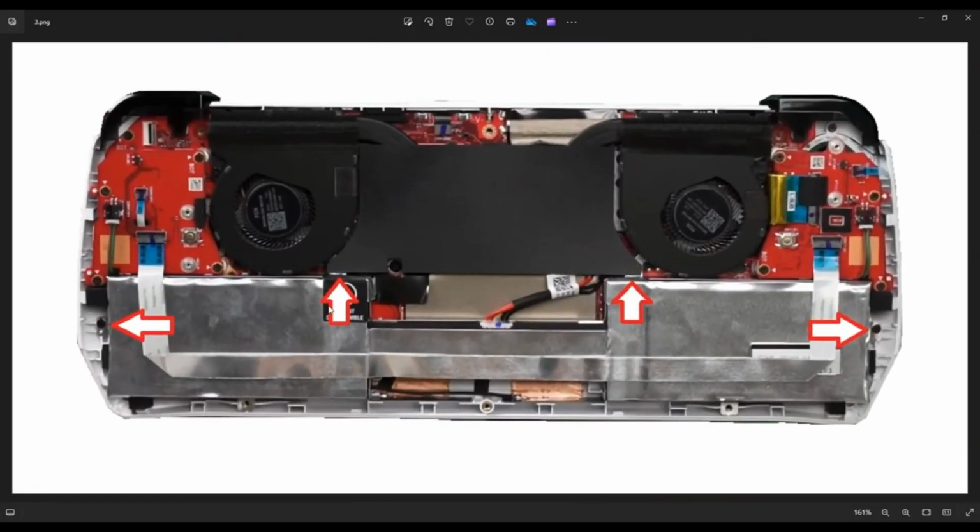After unscrewing all four of those screws, guys, you have this plug right here that comes from the motherboard that plugs into your battery. Instead of pulling on the wire, which is never a good idea, take the actual white plug out. You can do that if you can get your fingernails on each side of those grips, maybe a small pair of pliers, a plastic pry tool, something other than pulling on that cord.